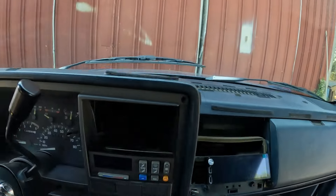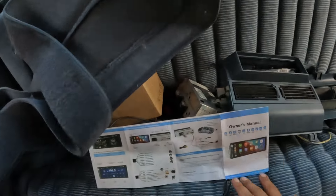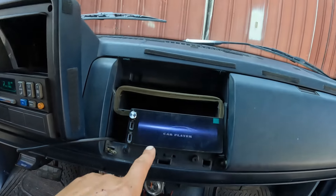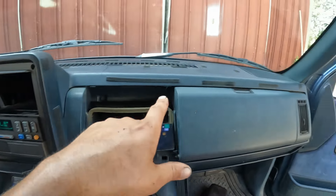I didn't want to go crazy in depth on all the wiring and everything else, but we got all of this stuff ripped apart, everything kind of wired up, and got the old radio stuff out. We're trying a cheapo $50 Amazon head unit. I got everything wired up, and I was hoping this would fix the speaker problem, which it did not. This is all working, this is functioning. I do not have any power connected to my phone, I do not have any power going from there to the speakers. So all of the amps are bypassed, everything else is stripped apart. The only thing I can think of is that these speakers are completely shot.